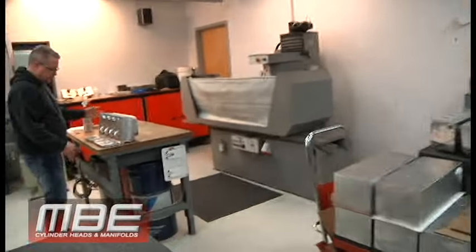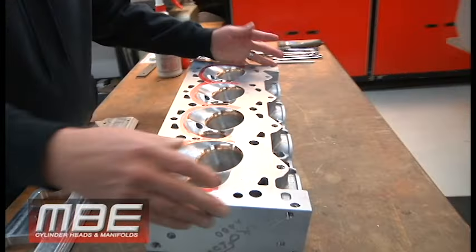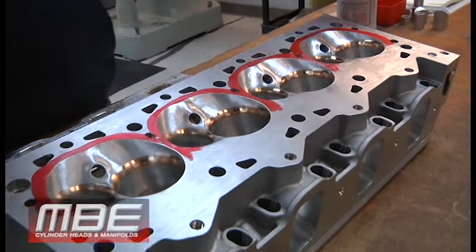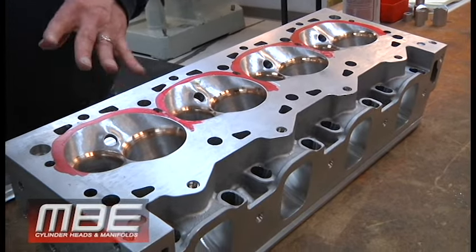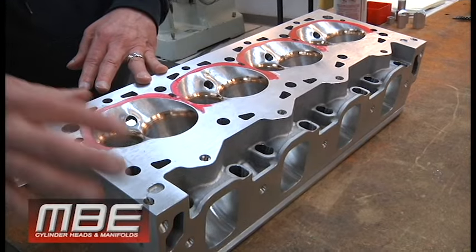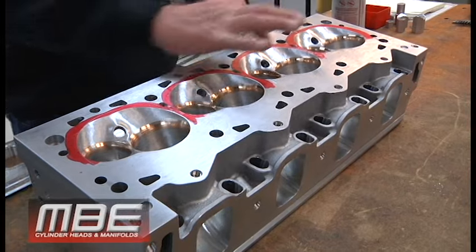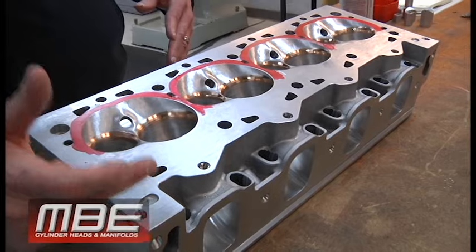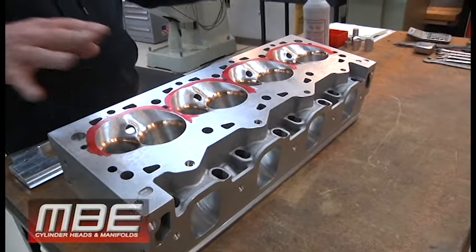And we have our A460 cylinder head right here. So this is after it's been angle milled. Then we go back and redo the chamber after it was angle milled. When you angle mill something, you cut more off of here than here. So this is like a 0 to 120. Your first cut is like this, and then it just gets wider as you go. So 120 thousandths here, and then 0 here. But anyways, that gets the chamber smaller.